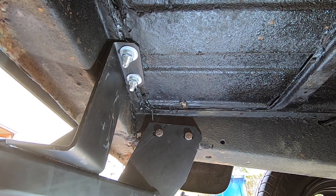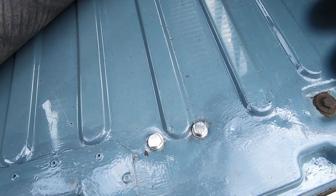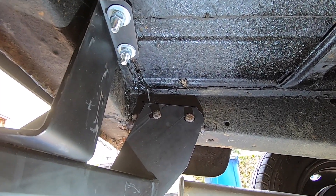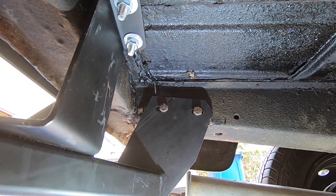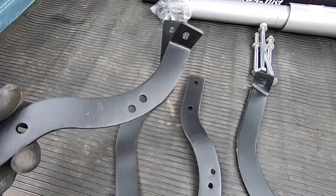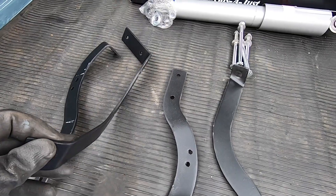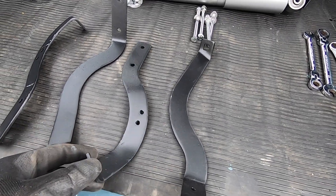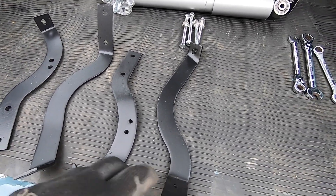Underneath the car you can see the two new silver bolts which go through the boot floor. They're quite close to the rear cross member but they do fit quite nicely and were quite easy to drill and attach. Over there is the plate for the side of the tow bar with the two bumper hanger bolts, which I'm going to replace with the longer ones. It's quite an easy job - just line it all up and bolt it back together. Before I put these back on the car I wanted to show you these bumper irons. I took each one off, cleaned it up with a grinder, and sprayed it with a little bit of matte black paint because they were covered in underseal, crap, and bits of rust. I thought I'd clean those up so they look a little better and last a little longer.